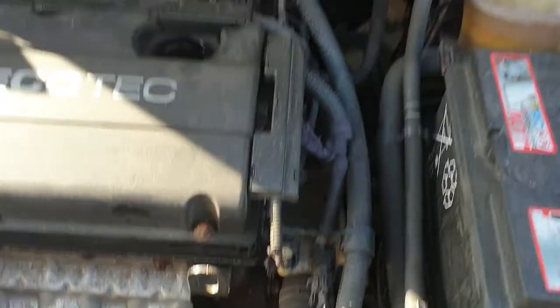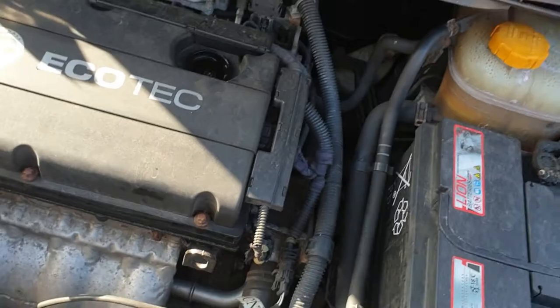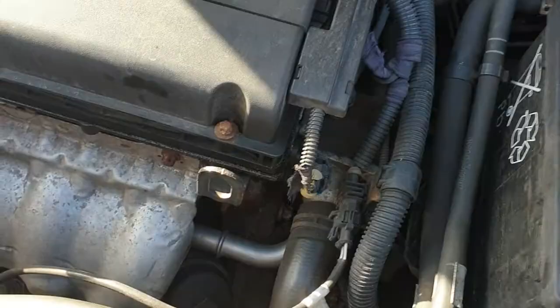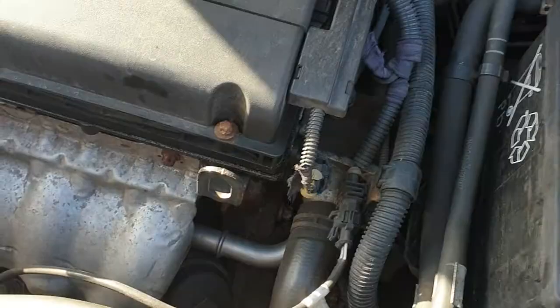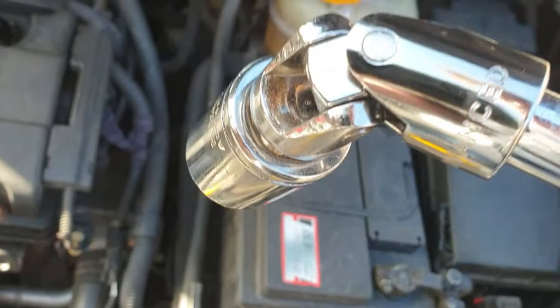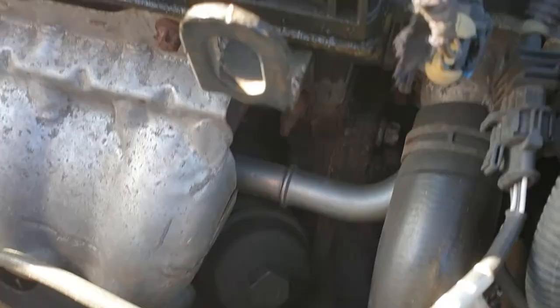Here's our filter down there, and funny enough the flex head spanner set I'm using has got every size except for the one I need, which is 23. I'm going to have to go into my kit and pull out a 23 socket and extension. As it turns out I tried a 24 spanner — it was too big — but I tried a 24 socket and it appeared to be just right. I've put a flex head on this with an extension and a large ratchet and it's freed it, so now we can release it the rest of the way by hand. Obviously be careful underneath because it's going to drop quite a bit of oil down.